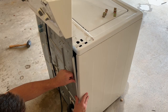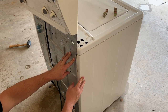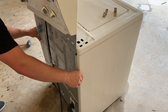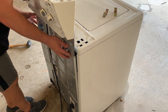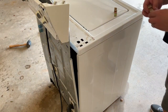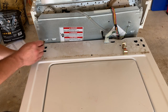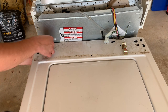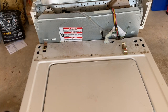Don't forget to plug your lid switch back in. These plastic pieces should go inside this side of the washer on both sides, and they'll be held in tight once you get your lid clips on. With the plastic piece in place, line it up, slide your clip in, then press down to clip it into place.